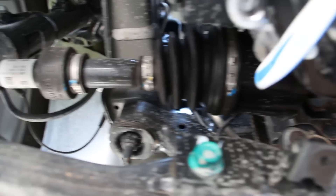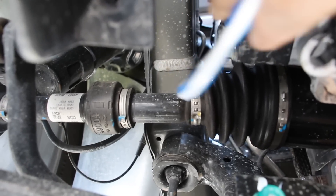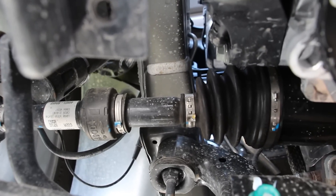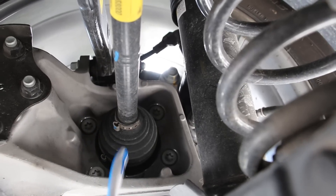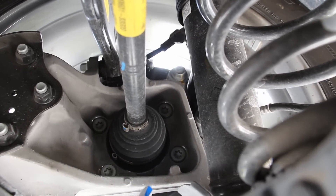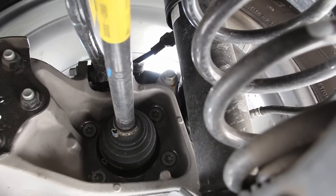Comparing the size of the axles — this one's the passenger side at the front — you can see this one's nice and chunky, and that's because most of the torque goes to the front wheels. The CV axles send power to the rear hubs here, which are luckily a bolted-on design, so if you have to change bearings it's pretty straightforward and you don't need a press.